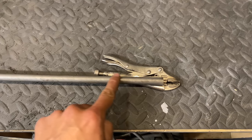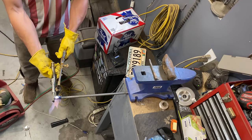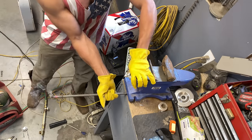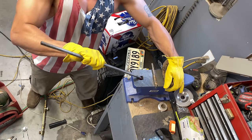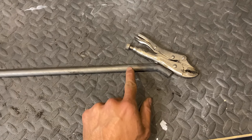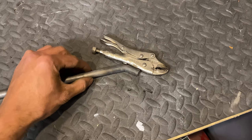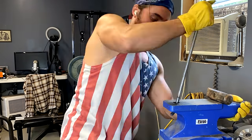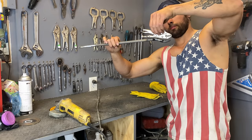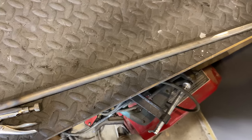Something that is key here is to ensure that the axis of pulling is lined up with where the mouth of the vice grip grabs, so I had to do a little bit of bending to make that happen. The idea is to bend it back so that the clamp itself will be in line, and I'm going to weld it on there. One of my favorite parts about creating tools to solve problems is that you get to use or learn new techniques to make the tool itself — it's all a learning experience.